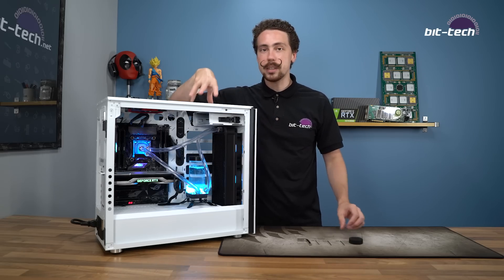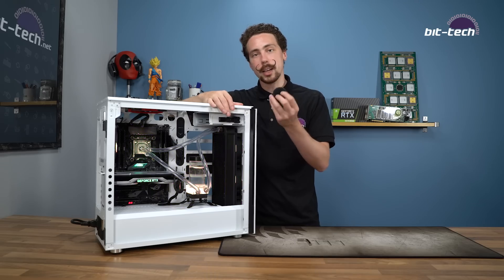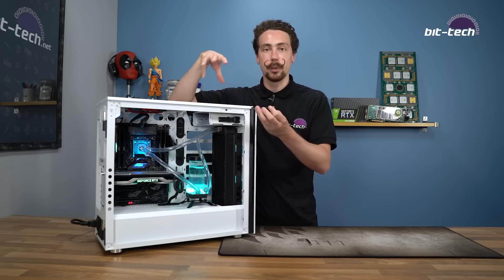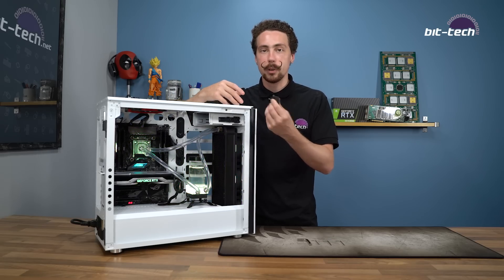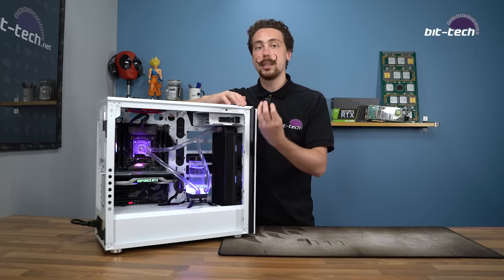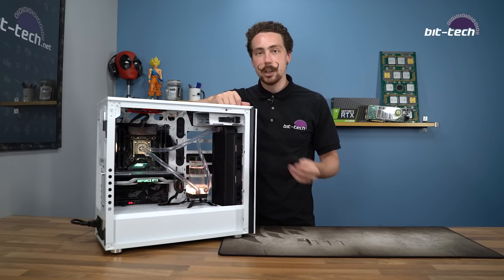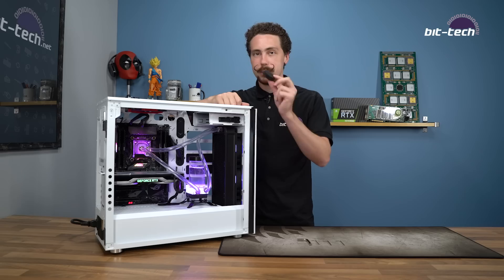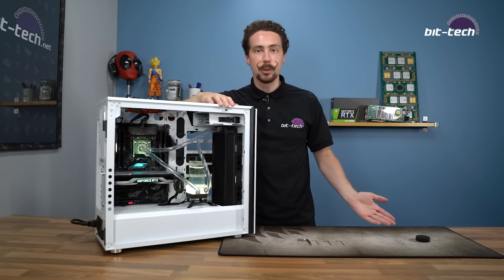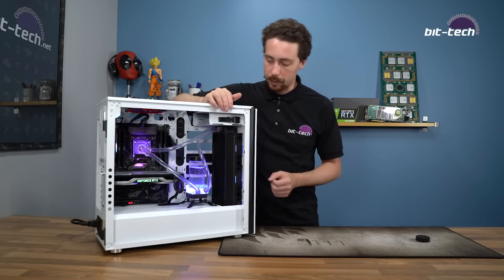Additionally because this pump isn't that strong, it also wasn't easy to fill it using the sponge that comes with the reservoir. This sponge is used to create turbulence and break up the flow so you don't just get bubbles going back in, and it acts as a filter. But it does put a lot of flow restriction in, and when we had it in the reservoir it literally didn't work — we couldn't fill it up at all — so we had to fish it out with a chopstick and put it on the side. If you're doing this with this exact kit for the first time, don't bother with it — just put it on the side. It's not even in the instructions and I've seen some actually break down in loops over time, so honestly I think you're just better off ignoring it.